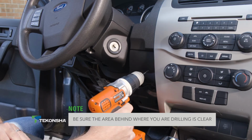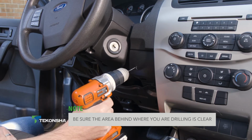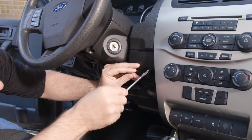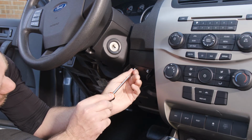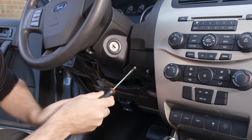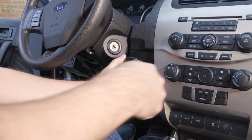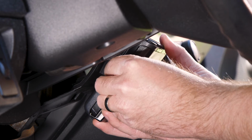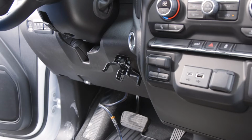Drilling pilot holes may make this easier. If you're using the traditional bracket mount, use the supplied number 8x3/8 screws to secure it to the vehicle's dashboard. Then, insert the remaining screws on each side of the bracket into the mounting holes to secure the brake controller. Adjust your P3's mounting angle to the desired position and tighten until snug.